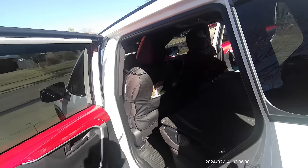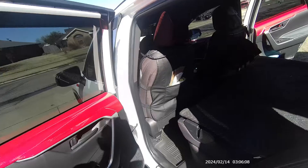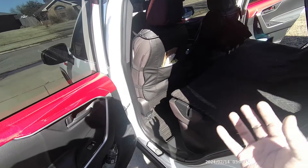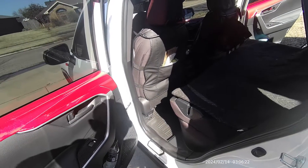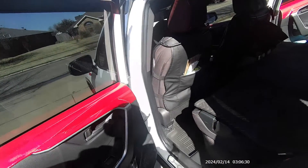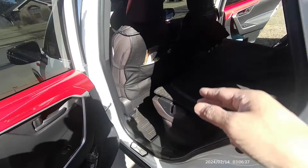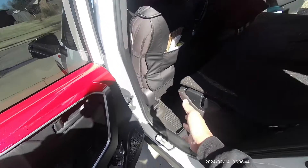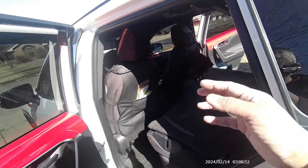With that in mind, think of it like changing a light bulb — yes, you could turn off the electricity at the wall or at the circuit breaker box, but myself, I know the precautions. All I do is unscrew the light bulb and put a new one in. The bottom line: don't touch any of the inside. The same applies to the cables here — as long as you're not poking around in a voltage cable, you'll be okay. But again, disconnect it for safety, because you've got 350-plus volts running through there. I usually just let the car settle for an hour and then work on it.